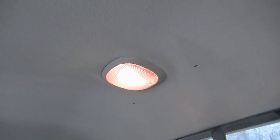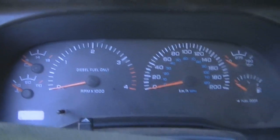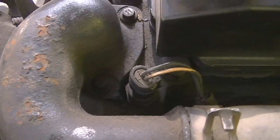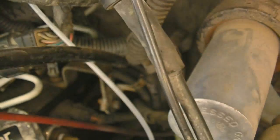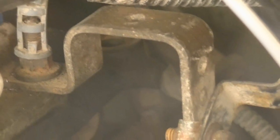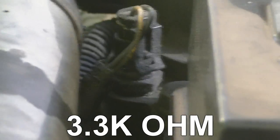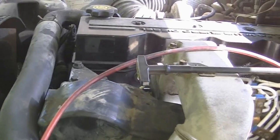I replaced the LED thing with a regular light, but I want to see if high idle has been flashed into the computer. The only way to do that is to trick the computer into thinking it's really cold outside. To do that, we need to locate two sensors: the coolant temperature sensor and the air intake temperature sensor. You need a 56,000 ohm resistor for that one and a 3,300 ohm resistor for that one, and then your truck will think it's really cold outside.